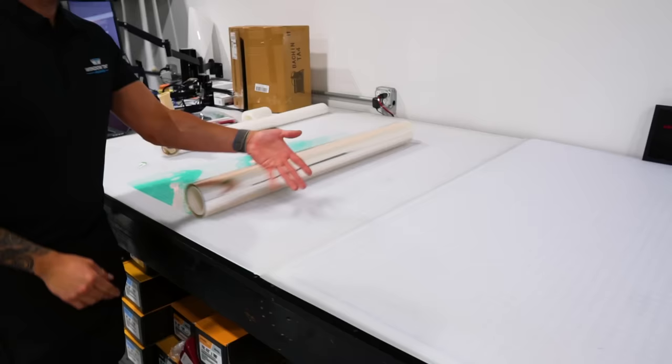It must have been something from this panel here, which is why you always should wipe your surrounding areas before you install. Static cling can happen and it'll just fall into the film. But we got that out successfully. If you ever lift the film up, you always have to spray more soapy water because you'll have air pockets if you do not.